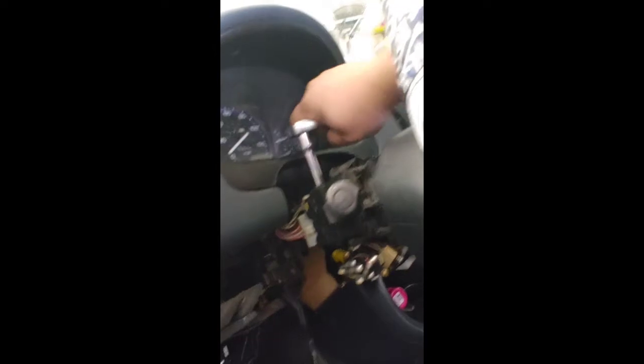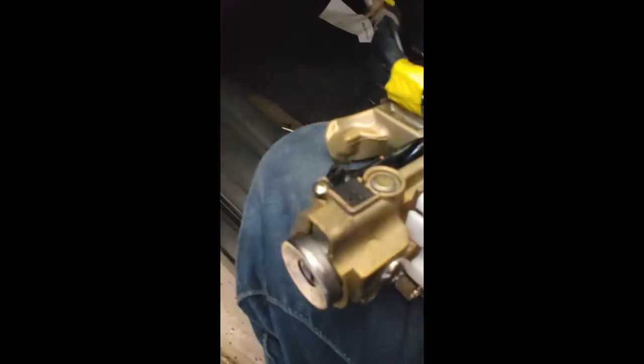So that's that. I'm going to take off these bolts. Once you've got those bolts removed this will just kind of hang down. If it's never been replaced before there will be zip ties. This one's been replaced so I'm just going to pull the wires through like that. There we have the old ignition switch and steering wheel lock. I've got a couple things to transfer over because the new one doesn't have this piece or that piece or that piece.